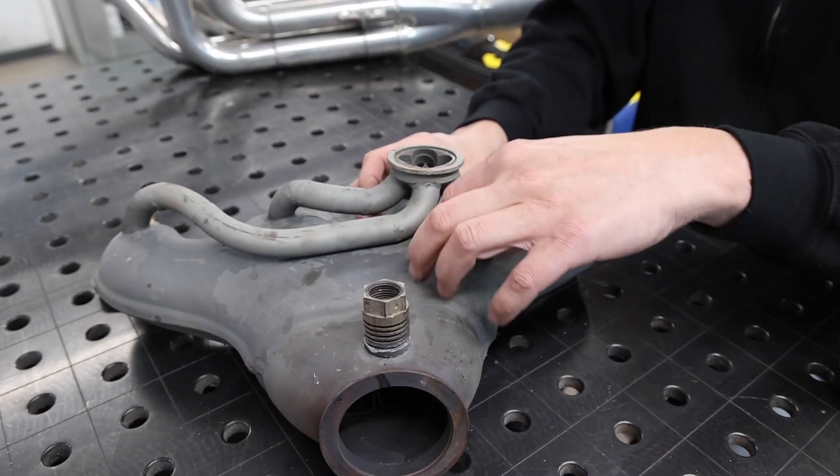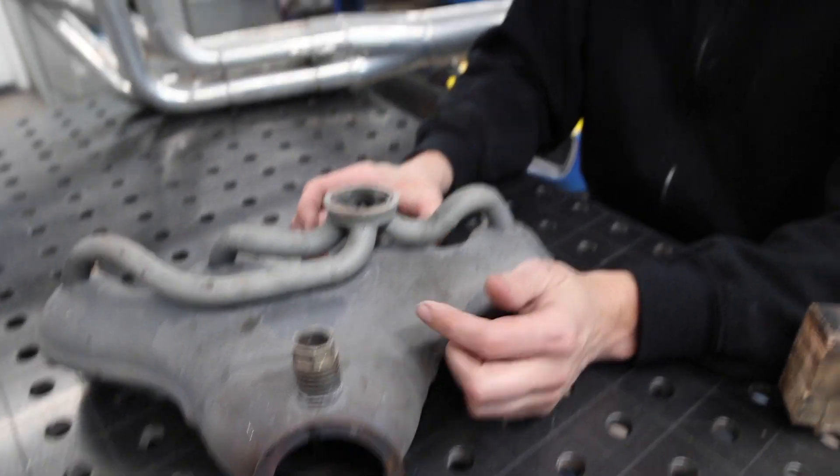Also the volume goes from larger to smaller as it goes into the stamping, which is kind of restricting it a little bit, which is also going to increase the back pressure and increase the temperature. So if you're doing a turbo setup, that temperature is going to cause issues for you. If you're doing NA, that back pressure will cause a lot of problems because any engine likes to work with pressure differential across the intake to the exhaust. If you have more pressure on the intake than you do on the exhaust, you make more power. It's kind of like getting boost on an engine.